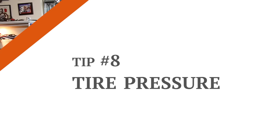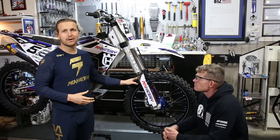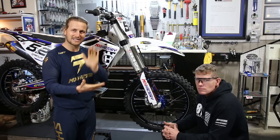Tip number eight: I want to talk about something that may not be your suspension. You may feel like the bike is super harsh or washy and it could all be right inside the tire. Make sure you have proper air pressure in your tires. Personally I like to run between 12 and 13 PSI on the tracks around here. That's going to vary depending where you are in the world, but not more than a couple pounds of pressure. You don't want to put 25 or 30 pounds in your tire because it's going to make the bike feel extremely stiff and harsh.